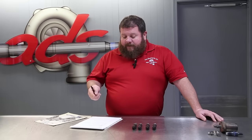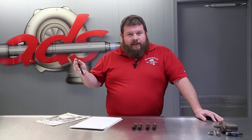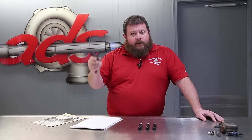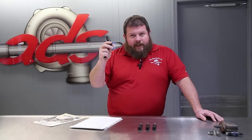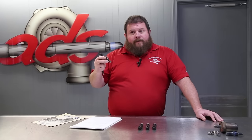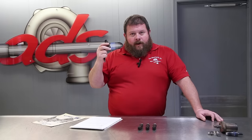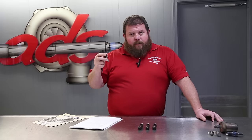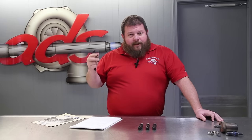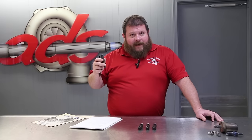This machine of John's is the early variation, so there were some changes. I'm sure there were many changes. The changes we're familiar with. This is the earliest design and, unfortunately, the least popular version of injector they put in these machines. As best I can tell, this injector was only ever found in the 1010 diesel crawler and diesel tractor. I don't believe any other applications ever use this specific injector, and that's going to fight us because part availability is an issue, to say the least.